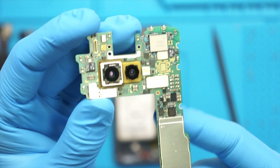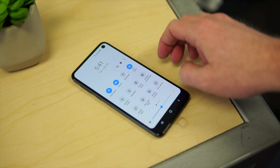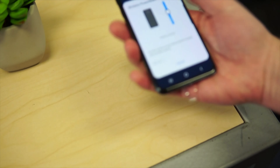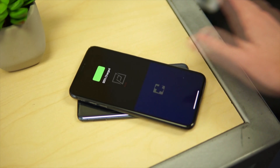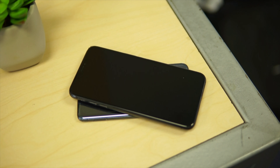We'll look more into the other features of the S10e, but let's tear it apart first. I've got my blue heating mat turned up to 70 degrees Celsius and the phone's been on there for just a little bit. Once it's hot, it'll retain the heat and make the adhesive soft, making it easier to pull apart. I'll make an entry point with the razor blade since it's thin and rather wide — this prevents high pressure areas and allows you to fit the plastic playing card in easily. Work gently around the edges and don't try to separate too deeply just yet.